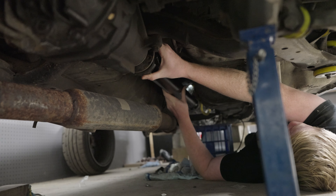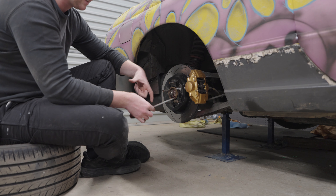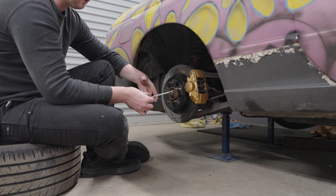The part we're trying to get to is accessible through this hole. It has two circular brake pads that go inside this thing and they push out against it. What we need to make sure of is that they are as close to the inside diameter as possible without touching, so it's the least amount of travel for them to make contact and lock this rotor - and therefore lock the back wheels. Got to go all the way down until the shoes go outwards and basically lock it in place.